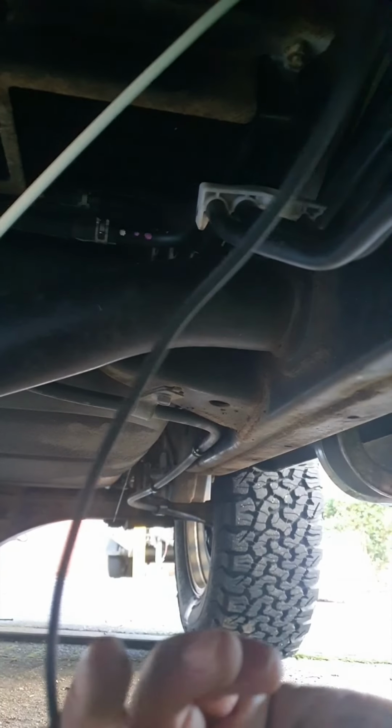Okay, feed the cable all the way along from the rear, all the way along the chassis. This is when you'll need extra tie straps. Tie strap at every foot or so along the existing cable, and then the cables run up through this rubber grommet. This rubber grommet is underneath the passenger seat. Okay, and you're wanting to maybe just pierce a wee hole in that, feed your cable through. Then use some sealant so the water doesn't get through. Okay.